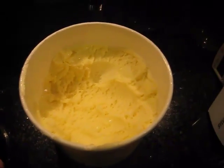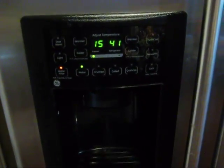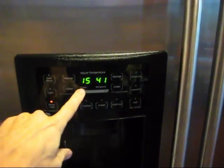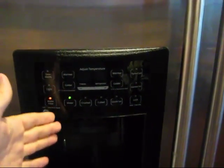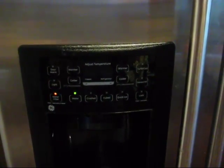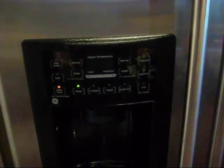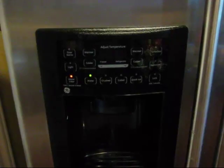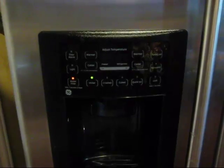There's my wife's soft serve ice cream. Of course, instead of putting the refrigerator freezer on a timer, you could just increase the temperature of the freezer and the refrigerator, so it would normally be at 15 degrees or 41 degrees. However, you would never really know when the refrigerator and freezer cycle on and off, and you wouldn't have total control of how much power it uses. By having it on a timer, you absolutely know it's not going to use more than 30 minutes of power in a two-hour period — something to consider when you're looking to conserve power.